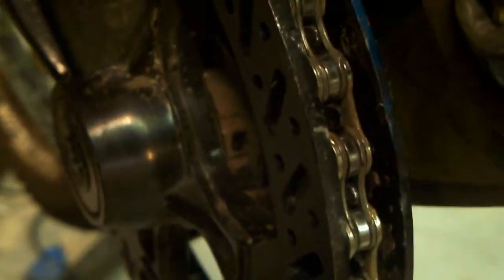The only reason why I did this is because I have a 32, I have a 9-speed cassette and I have a 34 tooth rear cog over here. And that gave me the extra ratio. To be honest with you, I could get the ratio nearly exactly what it used to be if I switched this to a 10-speed cassette instead of a 9. But of course that would mean these shifters would have to change as well.